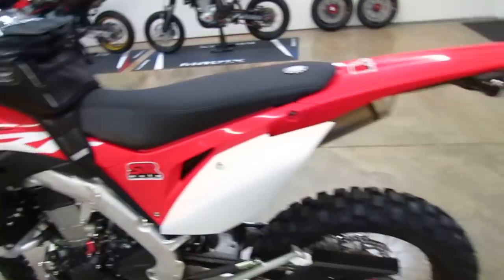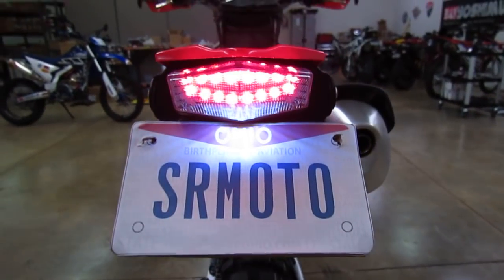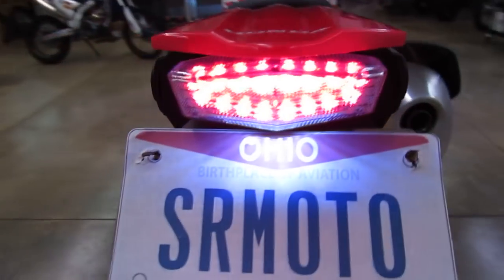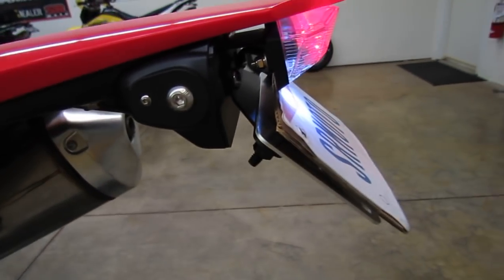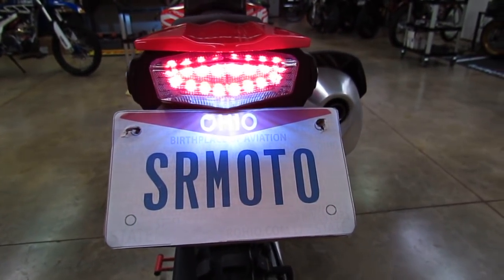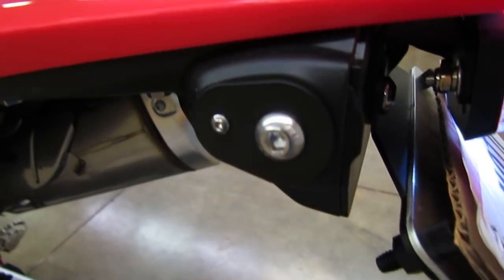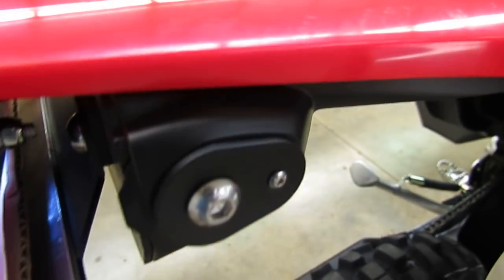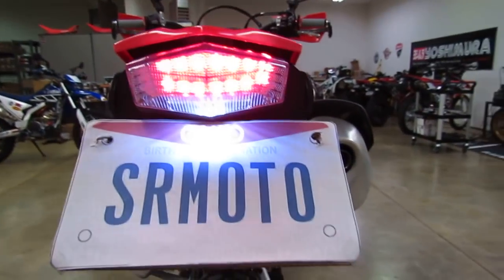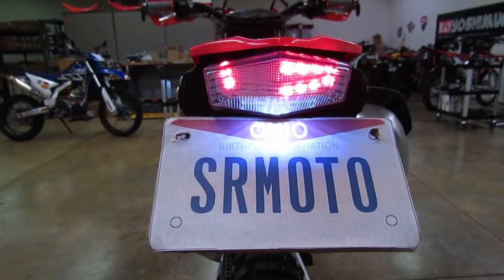For lighting and electrical changes, starting with the tail light: this is the 12 o'clock labs integrated tail light and fender eliminator. It's a real nice tail light that cleans up the back end of the bike — simple plug-and-play installation. It replaces the stock tail light with an LED unit and includes a license plate mount. It can be used as an integrated tail light where the turn signals flash within the tail light itself, or with your stock turn signals. We've taken the stock turn signals off this bike and used the included plates to cover those holes. There are five or six different programmable flash types — we're running the default scrolling flash.